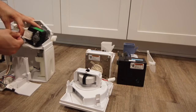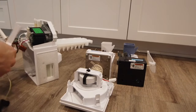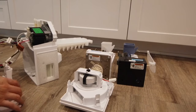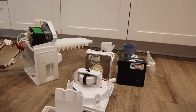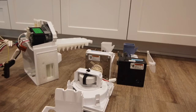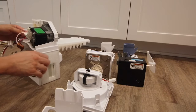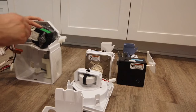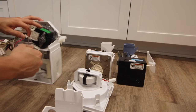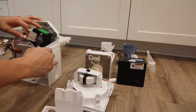If you have a flat head screwdriver you may try that, but also be careful. Once you start pulling out the wires, just remember to do everything in reverse once you put in the new ice maker. Best thing to do is take a photo before you start pulling out wires, in case you forget which wires go into which socket and which adapter.